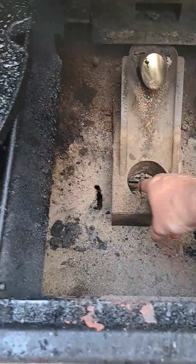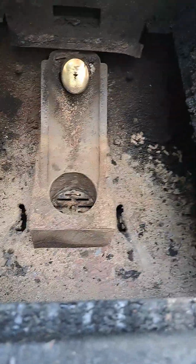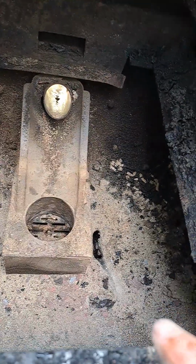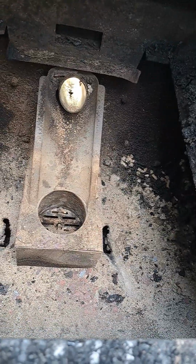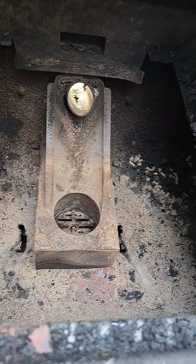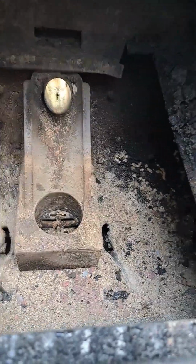It barely works. So this is what they call the flame pot. I've had more problems with the flame pot than anything. The problem I have is if the grill isn't seeing the temperature, let's say the igniter's on but it wants more temperature, it just keeps feeding more pellets. And quite often it overwhelms the fire pot, and then I've got a pile of pellets here that I have to clean up. Once I clean all the pellets out, the igniter is usually still hot and going, but I'll get a coffee can of pellets pulled out of here, and then the grill will start going.